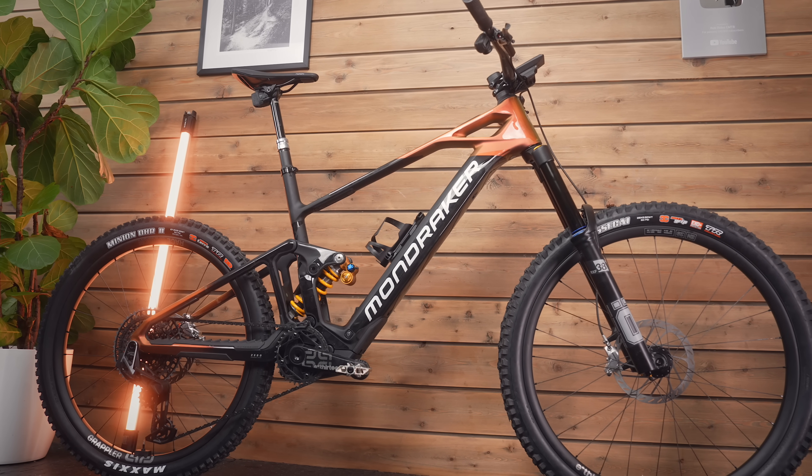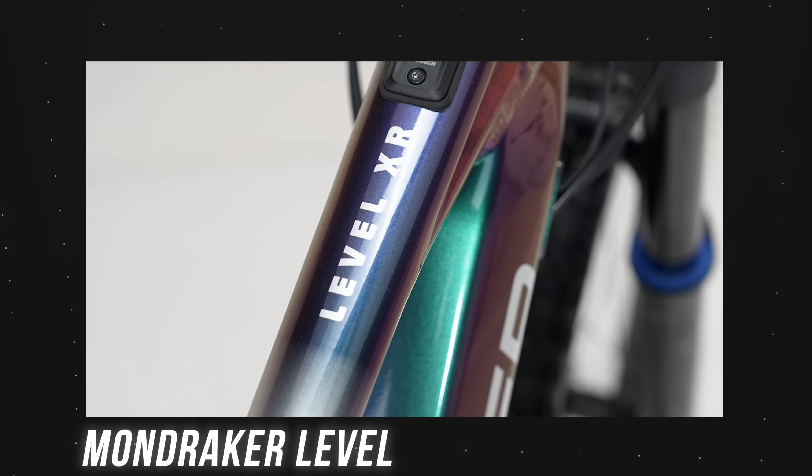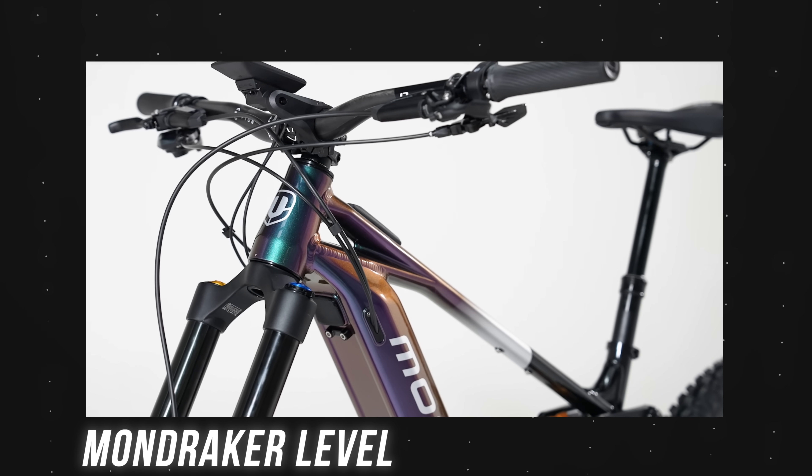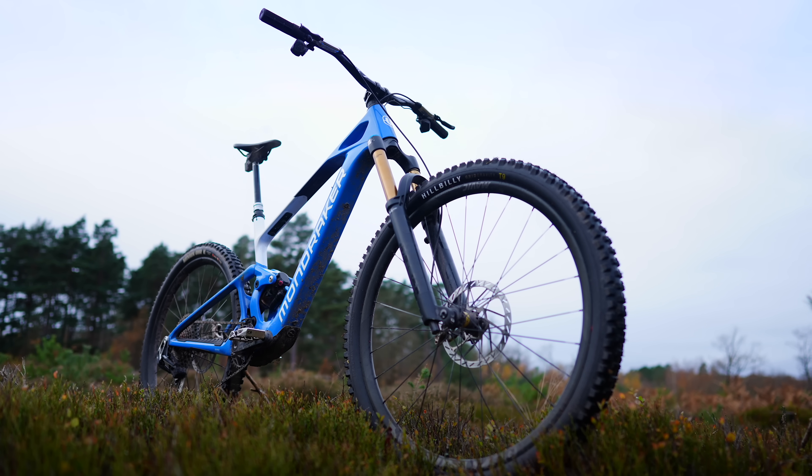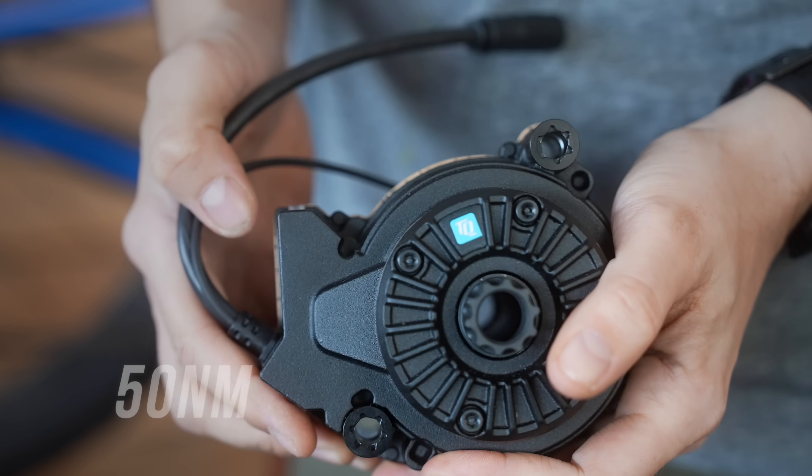It's got 165 millimeters of rear wheel travel and a 180mm fork out front — a super enduro lightweight electric mountain bike with super enduro geometry. At the top end heavy end, full-powered e-bikes have big batteries around 700 watt hours, normally around 23 to 25 kilos. At the very light end, we've got bikes like the Mondraker Neat, powered by motors like the TQ, which are more like riding a mountain bike with a little extra power, as light as around 17 to 17.5 kilos.